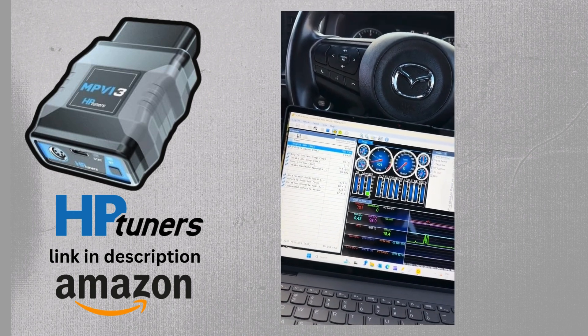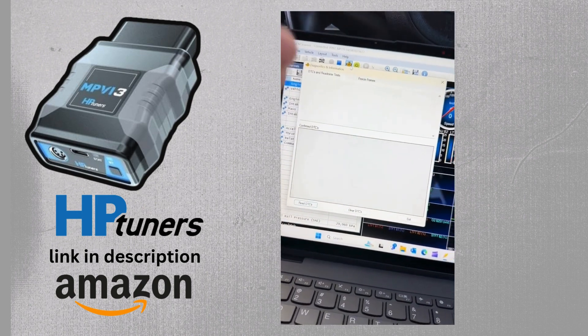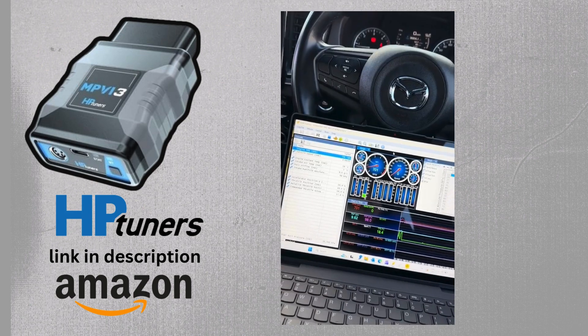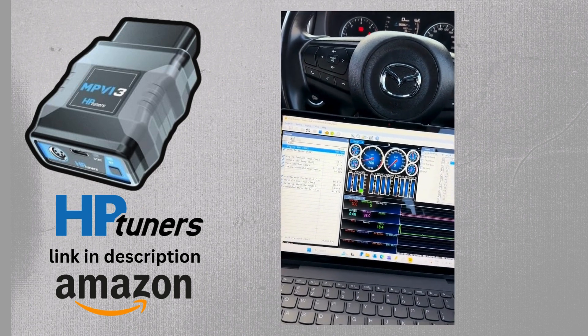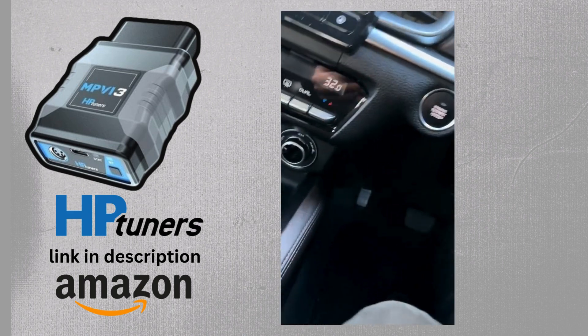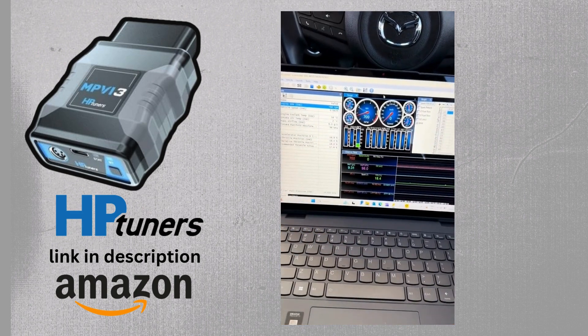This vehicle doesn't have any engine lights or anything, but you can see if you click on there you can read them, you can clear them, and you've got freeze frames as well so you can go through everything. This is a very handy tool to have on the fly — not in the shop. It's quite literally just plugged into that, straight into the laptop, and we can check everything out here.